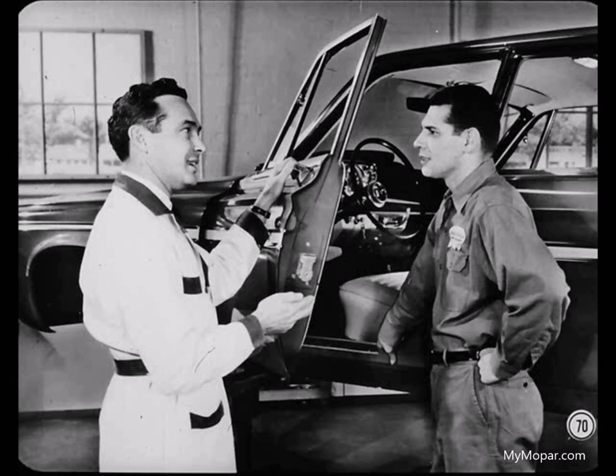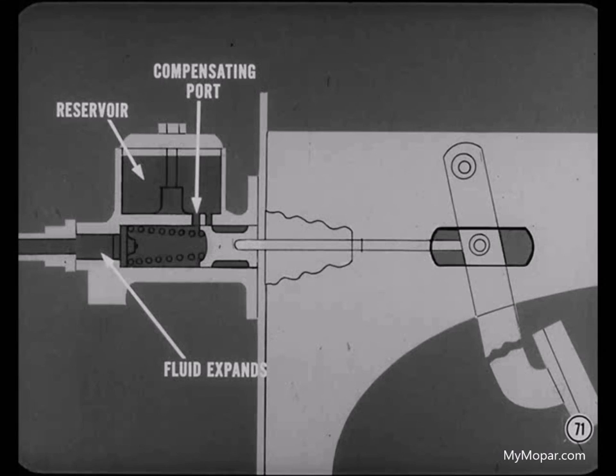That's the story on shoe knock, Ben. Now I'd like to tell you about brake shoe drag caused by brake pedal buildup. What is pedal buildup? By pedal buildup, I mean loss of pedal free travel. As you know, the fluid in the brake lines will expand when it's heated. Normally, the expanding fluid flows back into the master cylinder reservoir through the compensating port when the brake pedal is released.